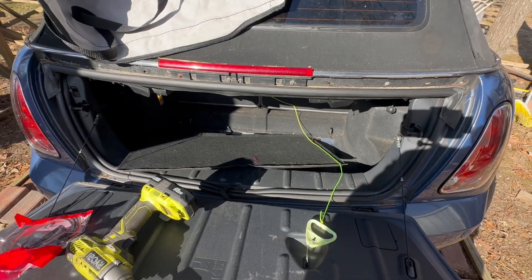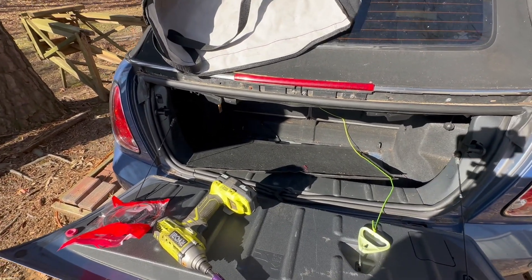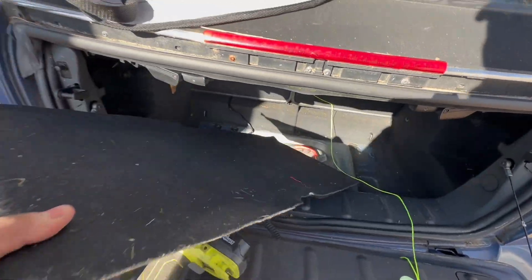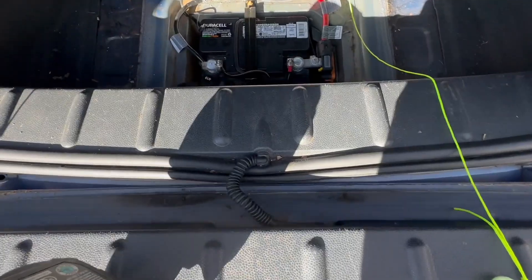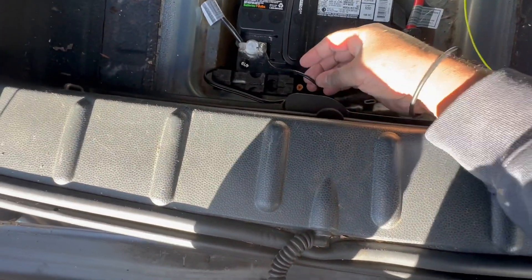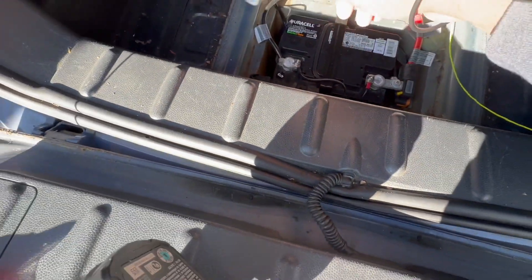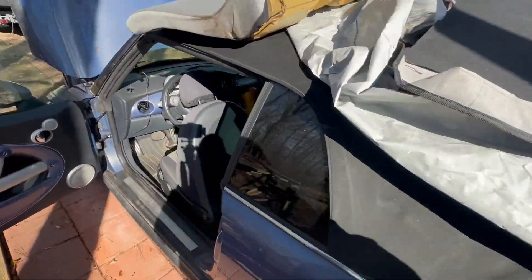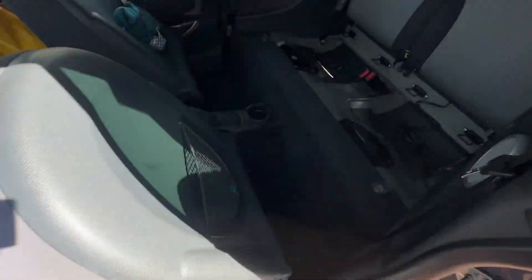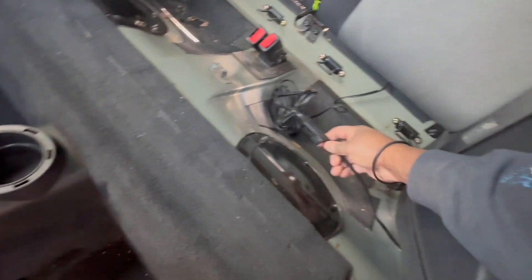For this modification, all I need is a 10 millimeter to disconnect the battery and put on the new eyelets. This convertible top is removable so I'm going to remove it and stick it up on the roof — that gives me access to the battery. The old cord is black; this is the negative side, here's the positive side. I'm going to disconnect these two. It runs underneath up there, under the seat. I took the back seat lower cushion out — that needs to be washed — and inside the car there's all this excess wire.